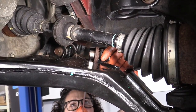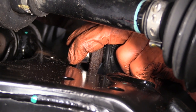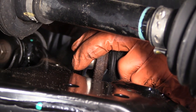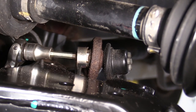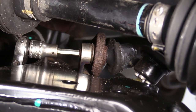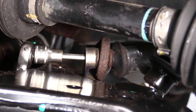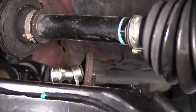I'm going to break the inner nut free on that sway bar link — it's a 14 millimeter like the lower. Now I can put the Allen head, which is a number five Allen head socket, right in the center because there's not much room for the wrench. I'll use the ratchet to back that off, and there you have it. So there is the sway bar link.